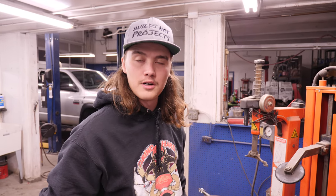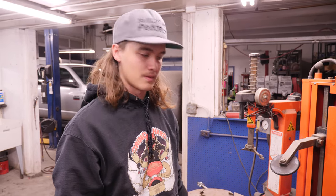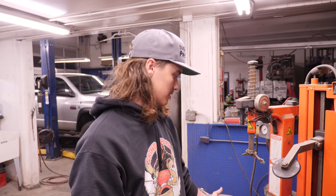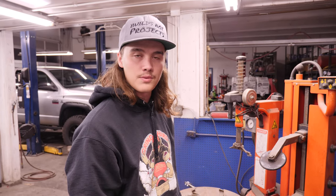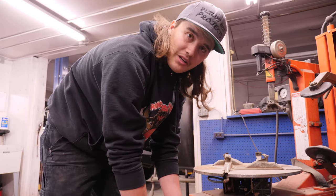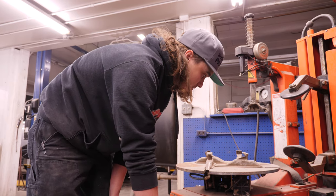The original plan of demounting the front tires at home did not go very well. These tires seated up really hard — they are ATV wheels, so they're kind of a beadlock design, made to hold onto the tire even when there's no air in them. So of course they don't want to come back off. Not having a tire machine to break the bead, we tried putting them in the vise and that didn't work. So we resorted to coming down to work to use the old tire machine that kind of works — it got decommissioned from doing car tires and now just does random stuff. We'll see if we can get these things broken loose and swapped out.